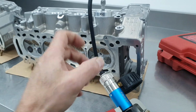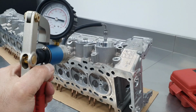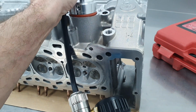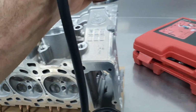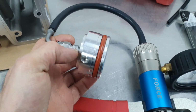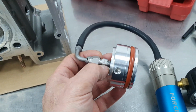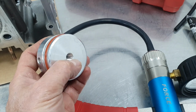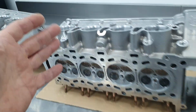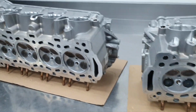I have this special adapter that I'm making vacuum with, and 1 second, I'll show you. Now I'm pushing to come out. Alright. Please don't scratch the head. So what I made on the lathe, I don't know how long I have this. There is this adapter that the o-ring comes from this side, and then you remove it from here and you put it also from that side to check the exhaust. I have already checked the exhaust, and I'm changing also the fitting. I'm taking the fitting from here and putting it on this side to check from both sides. One for the intake, one for the exhaust. Alright. Excellent. The Vaseline, what you see, is to help me out with the o-ring. Alright. Beautiful. Now it's the end.